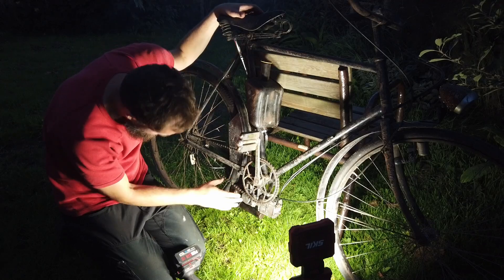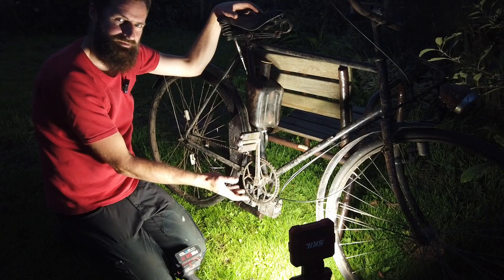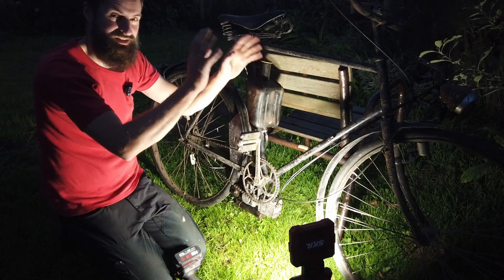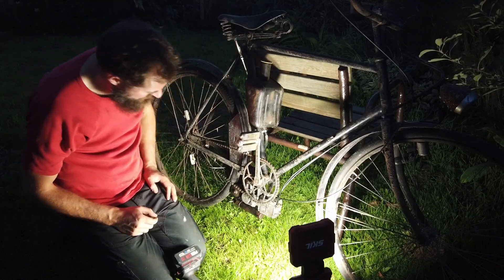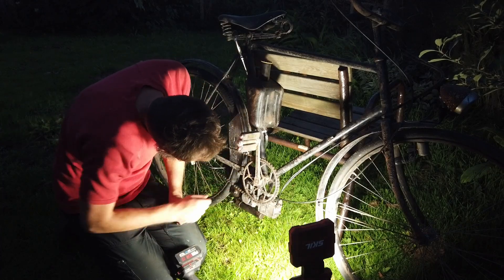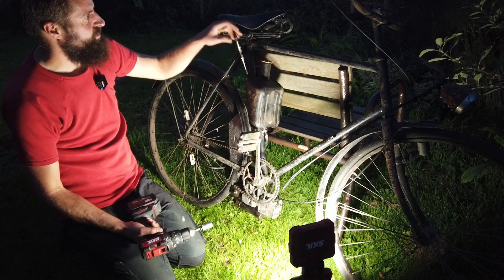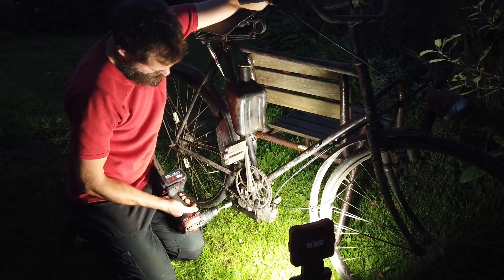I think I've got it now. It seems as though the adjustment on the fuel supply is a bit weird. I have to screw out the entire assembly a bit to give it enough fuel. And then it's very difficult to balance the two things — compression and the drip rate — to get it to actually idle. But I think it's pretty close to getting there. I'm a bit puzzled about why I have to unscrew the top part to give it enough fuel, so maybe the needle needs to be moved, or maybe it's just slightly clogged. I'm just going to give it one more try. It's really fun. A bit smelly, though.